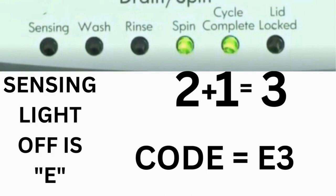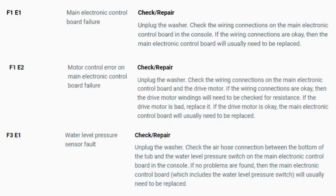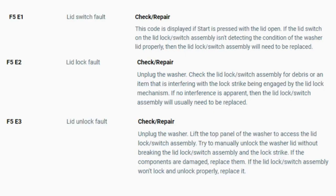The same error code flashes repeatedly until you turn the dial 1 click clockwise to show the next error code. Turn the dial again to see if you have any other codes; if there are no more codes, you're done. To exit diagnostic mode, turn the washer off. Now you have your error code — use the images in this video, look in your washer repair manual, or just Google your top load washer error code, and it should come up no problem. Now you know the problem and what's causing your washer to not work.